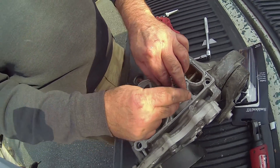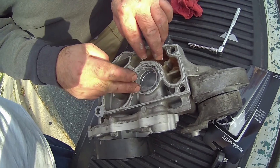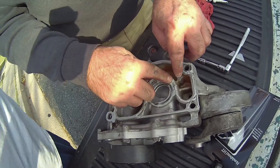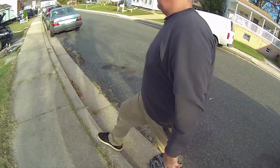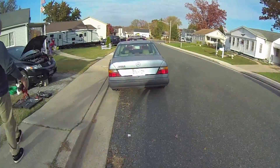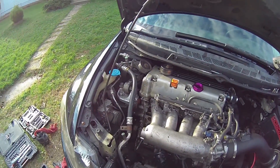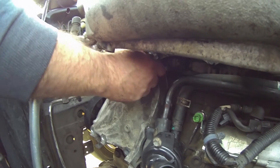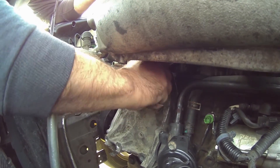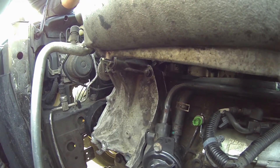The gasket seems like it's a little too big but it's the same one — it just looks like it doesn't want to sit. Put some Honda bond in it and it's sitting now. After about a minute of shoving and wiggling, you've got the assembly in. It's two studs and two bolts — put them back in their respective places with the whole assembly and new water pump in place. Tighten it properly so it seats and makes a good seal.